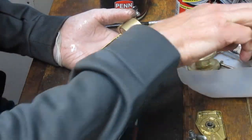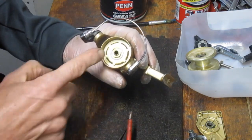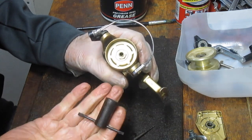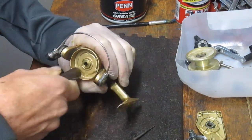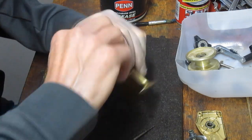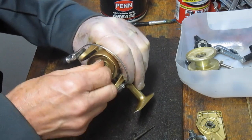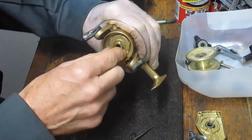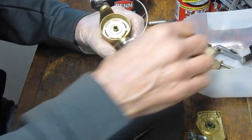This is the crosswind gear — that's going to go inside. The top is a 12 millimeter nut. I have a Mitchell tool that I use, but a deep socket 12 millimeter will work from any manufacturer. If you can sneak a wrench in there, go ahead. Most of these have a lip that makes the wrench a little tough to use. But if you can get the wrench in there and get it started, then just turn the screw off by hand.